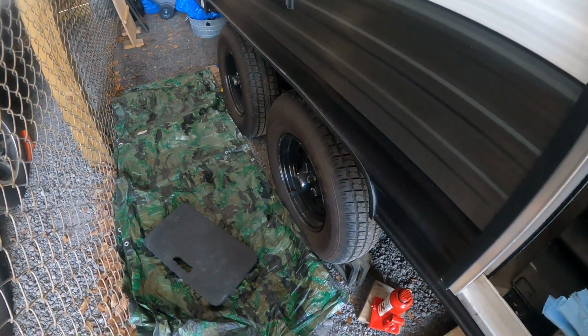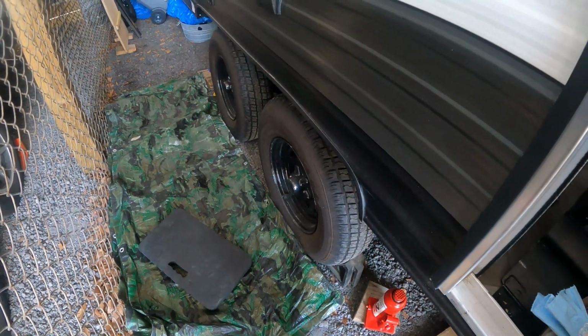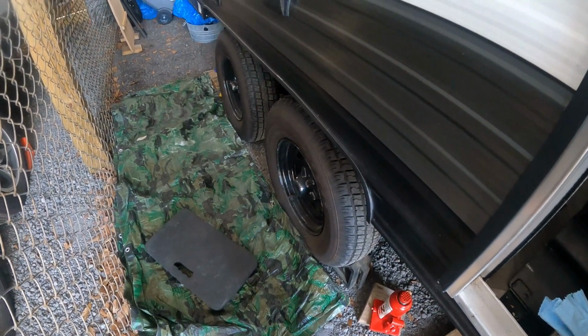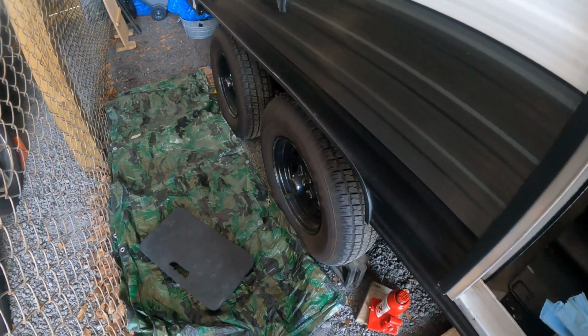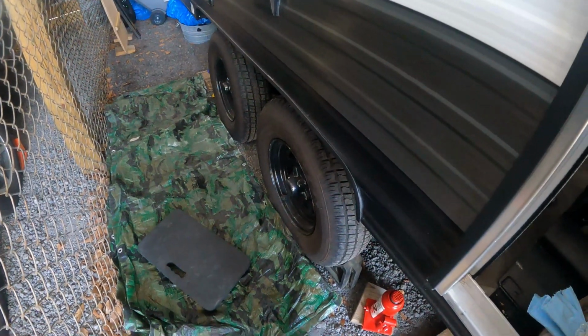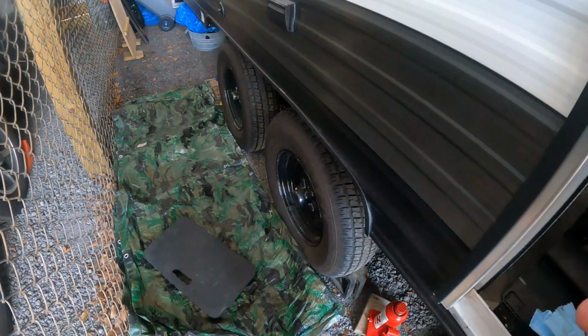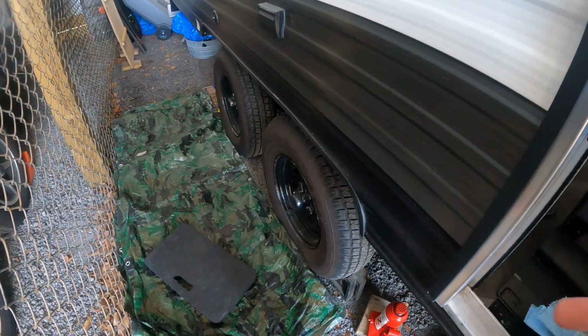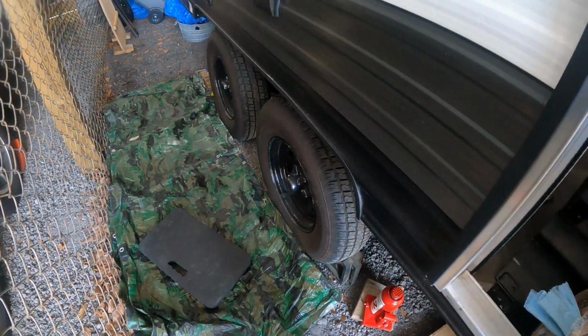Because if you're doing that, two things are happening. One, you've got a seal blown out. You need to pull that wheel off, check that seal. Make sure it hasn't blown out, make sure it's not starting to blow out and grease is getting out, because grease doesn't get used up. It just gets old. The only reason you replace grease is if you're doing what I'm doing today or you have a seal that's blown out.